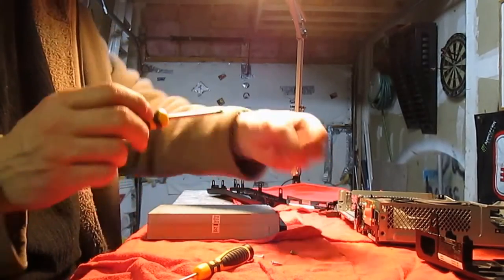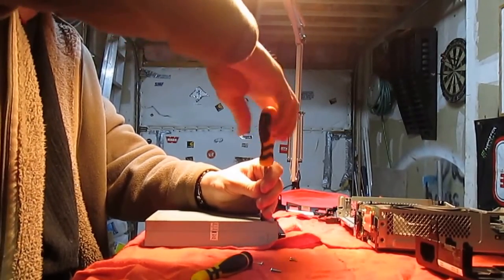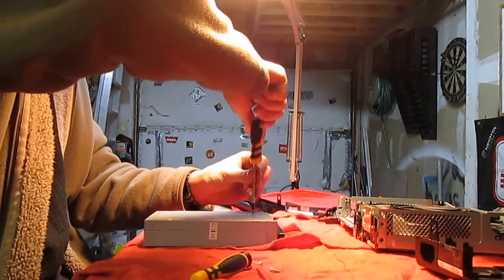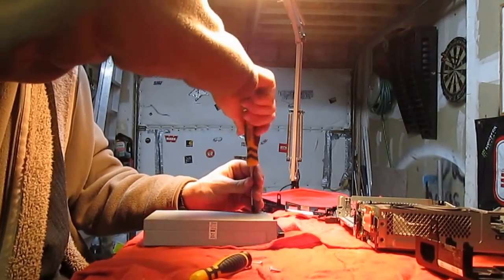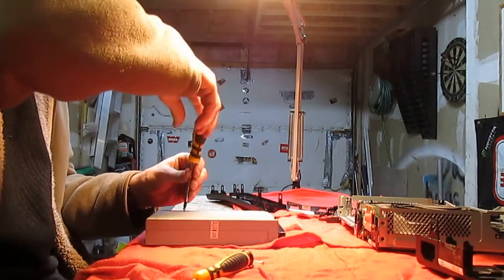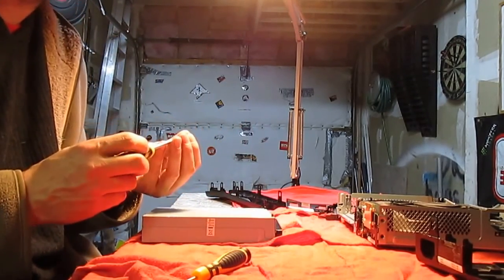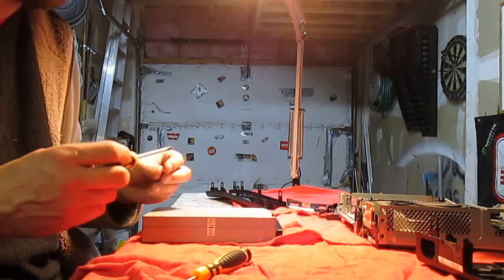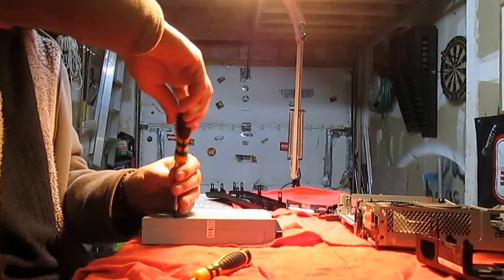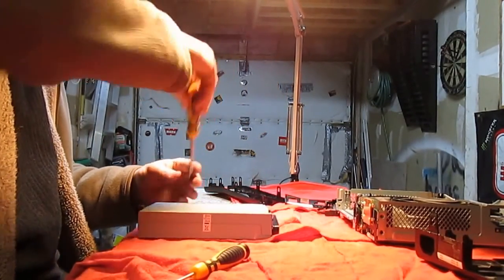Now you put the screws back in, 4 screws. You don't have to tighten them right up. It's not going to go anywhere. It's not like it's an automotive vehicle or you're doing brakes or steering or ball joints or tie rods. This is just a CD player for your Xbox. There is a little bit of vibration, but you don't have to wrench these screws down. If you do, you're going to run into a problem. Trust me. You don't want to wrench anything down where there's plastic involved. Just go tight, and then a little nudge. Don't tighten them all until you have all the screws in.